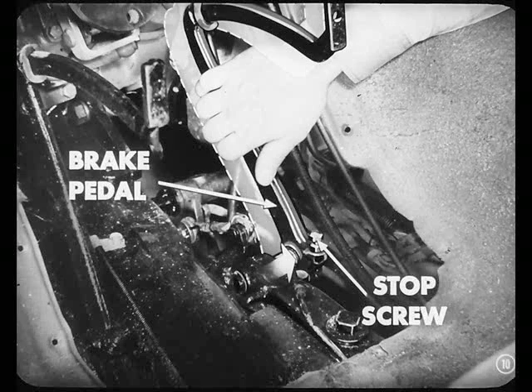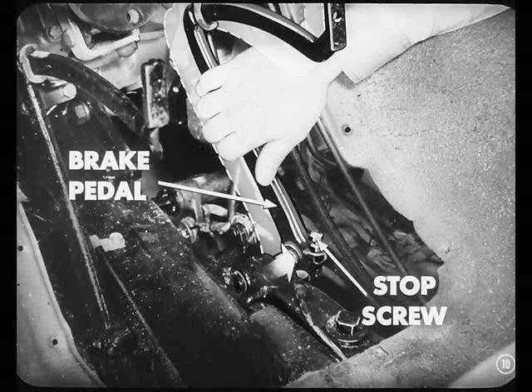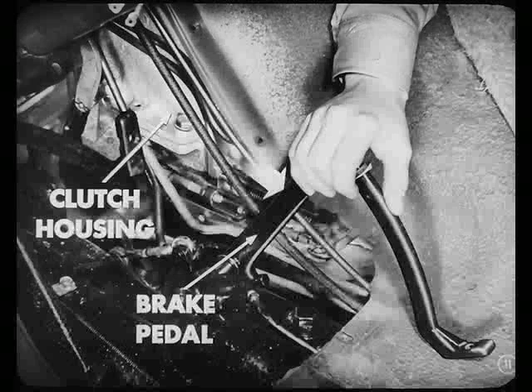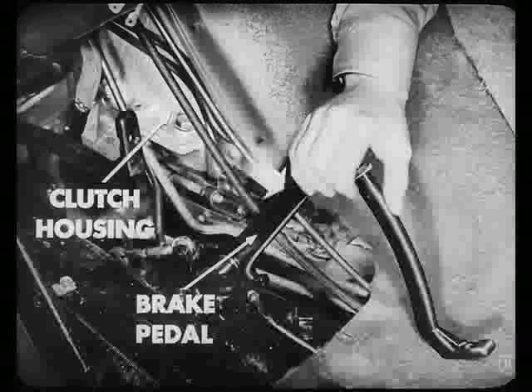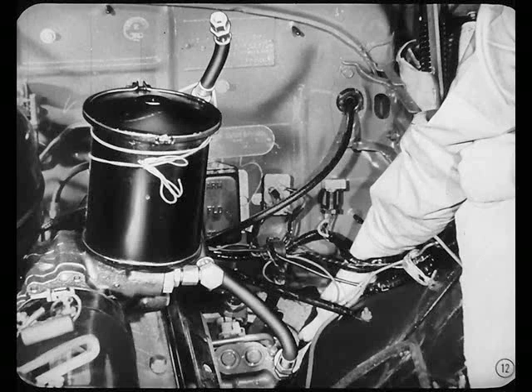When you're ready to remove the unit, you're going to have to slide the brake pedal outward on the shaft far enough to clear the pedal return stop screw. You're also going to have to turn the pedal back toward the seat of the car so you'll have room enough between the clutch housing and the brake pedal to remove and install the unit. When you disconnect the pressure and the return hoses at the valve body, tie them to the reservoir so oil won't drip from them. And don't start that engine after you disconnect those hoses or we'll all get an oil bath.